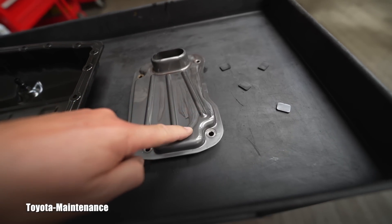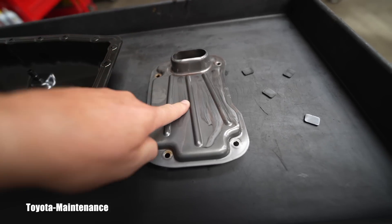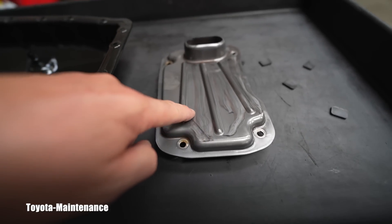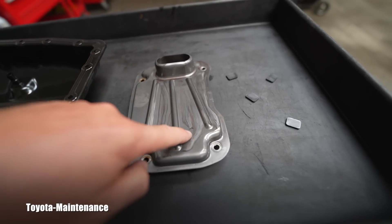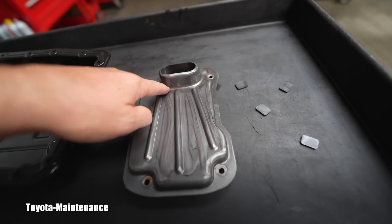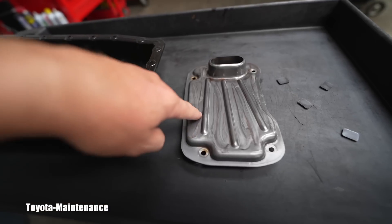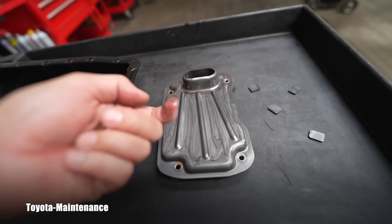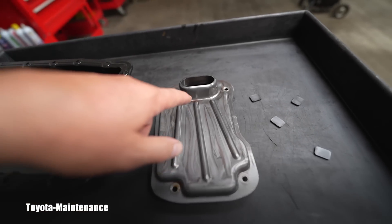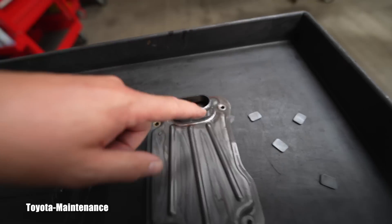This filter was floating in that oil. Do you see this? This is super fine shavings and dirt which occur because the transmission is doing what it's supposed to do — shift the gears. There are a lot of clutches and moving parts made of metal. You are basically looking to see if there are any larger shavings being caught on the magnets.